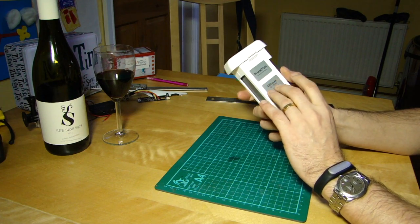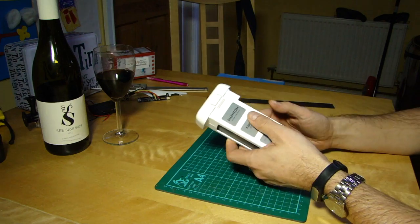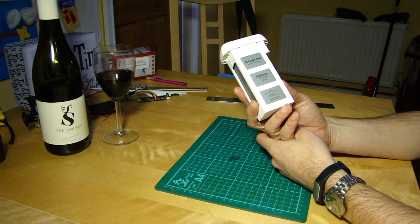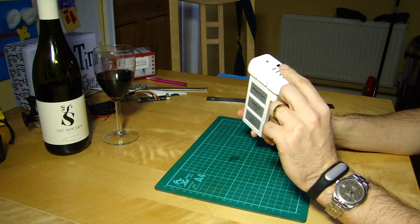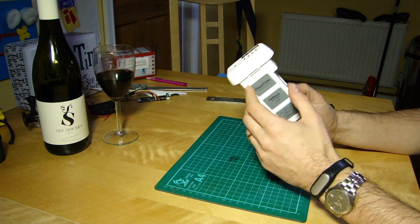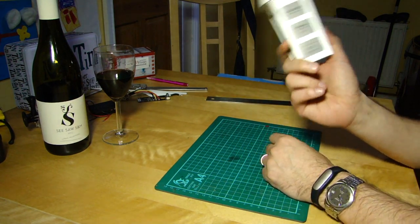They are unable to hold their full storage capacity, and that reduces over time — we've probably all seen that in our laptop batteries. When you plug this into the assistant you'll see it says design capacity and current capacity, and there will be a difference. So 100% of a new battery is not going to be the same as 100% of an 18-month-old battery. Discharging and recharging fully gives the circuitry a chance to calibrate where the battery's at, and to make sure it's giving you as accurate a percentage reading as possible.